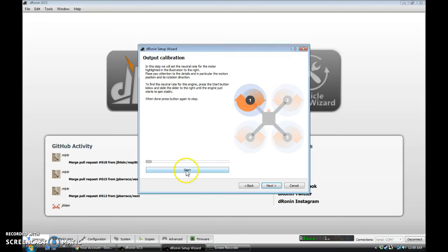Basically, you're going to do this for each motor. You're going to hit Start, and it's now sending a signal, but the motor still won't be turning. So you're going to move that up until it starts to move — somewhere right around here the EMAX will start to move. Then you'll try turning it down and it'll probably stop. You want to find the lowest point where it runs and stays running. If you pay attention when you're doing this, you'll notice that your motor numbering and positions aren't going to be matching up with how your motors are.